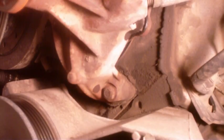Okay, so this is your water pump. There's one spot that meets the engine block, and there's the other spot. Four bolts hold this on, so let's get them. There's a bit of metric and a bit of imperial on this vehicle. The bolts for the water pump are 9/16. Get my impact for those.